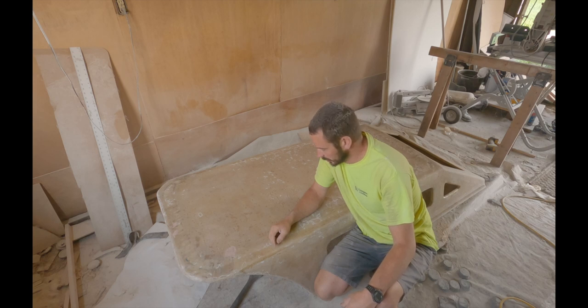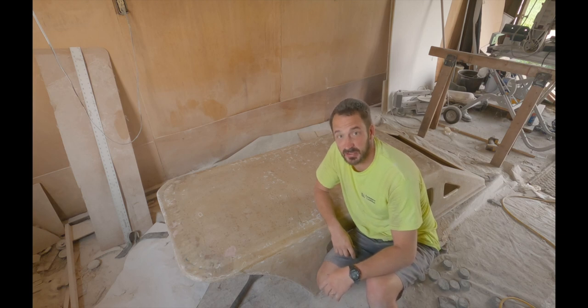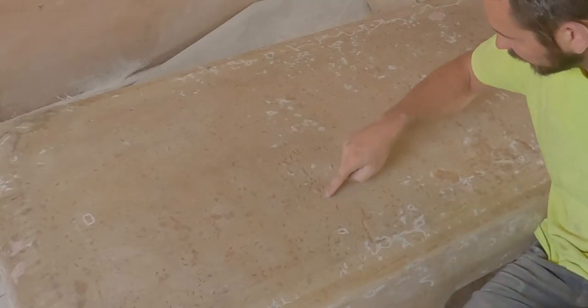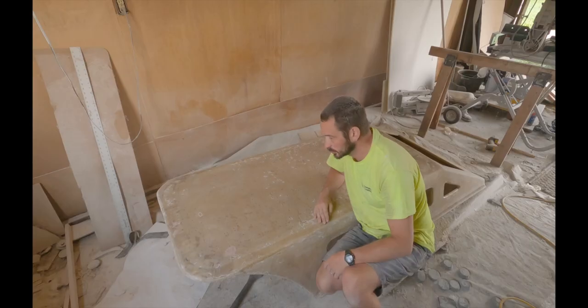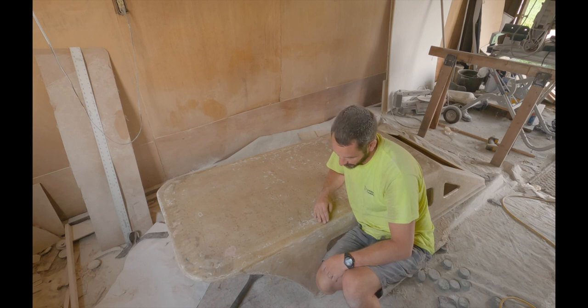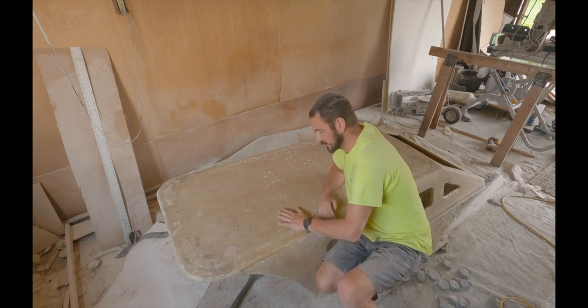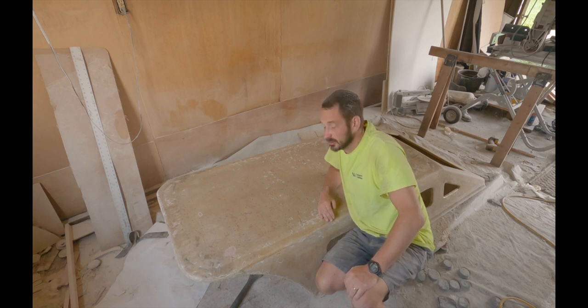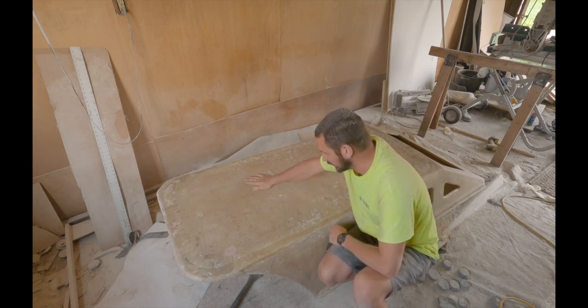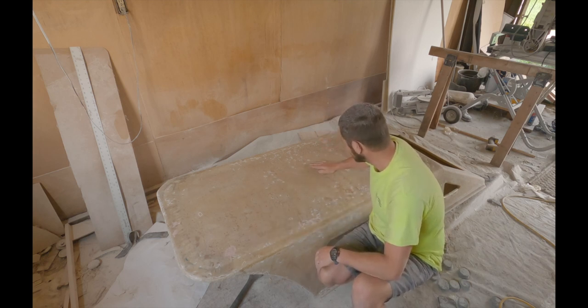It's been a little while since I've actually recorded — there's been a lot of sanding and a lot of resin added. It's not perfect; all these little tiny darker dots are what should be fared out. I don't have any fairing compound and we're leaving in less than three weeks on our trip. I've been sanding this morning for more than two and a half hours — started with 60 grit, then went to 80 grit, now down to 120 grit. I think it's as smooth as it'll go.